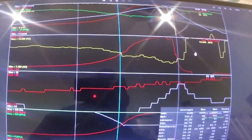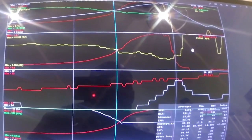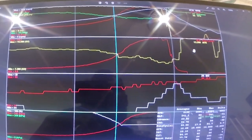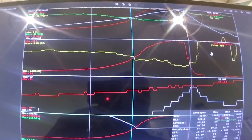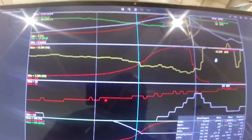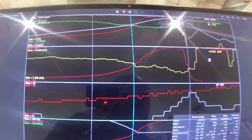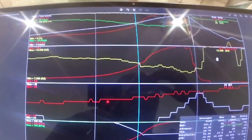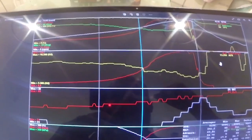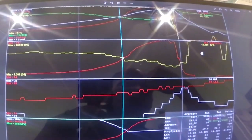The data shows that the bar-and-plate was much more efficient than tube-and-fin. I will caveat that by saying these are both around £100 each. I know there are more efficient tube-and-fins available if you spend a lot more money, but for us this is pretty good data.